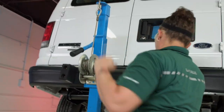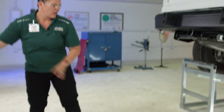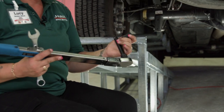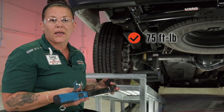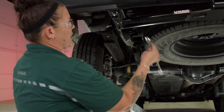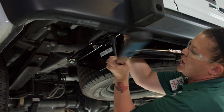So we'll get the jack out of the way and now we're ready to tighten up the hardware. We're going to use a three-quarter inch combo wrench, a three-quarter inch socket with a five-inch extension, and this is our torque wrench set at 75 foot-pounds. You want to get that foot-pound set correctly because it does make the hitch stable and safe. A lot of people will use impacts and other things for torquing the hitch. We're going to use the combo wrench on top to hold around the nut so it doesn't spin while we tighten.